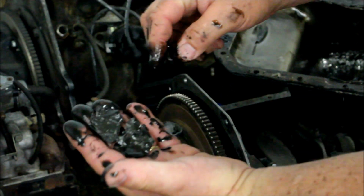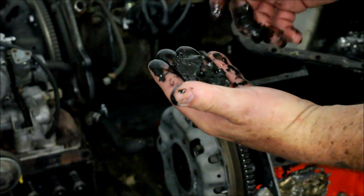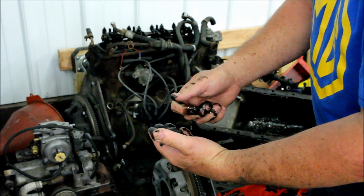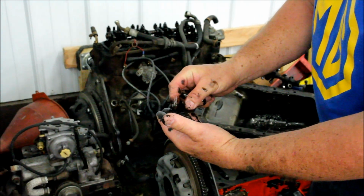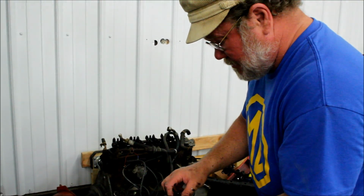Look at this. This is all rod bearing, huh? Hard to believe it's been hammered so, but when you take a piece of metal and start pounding on it, like the rod was pounding, for an indeterminate amount of time, but probably a couple of minutes, at every pound it makes the metal a little thinner, which makes the metal a little bit bigger. So this is quite a dramatic failure.